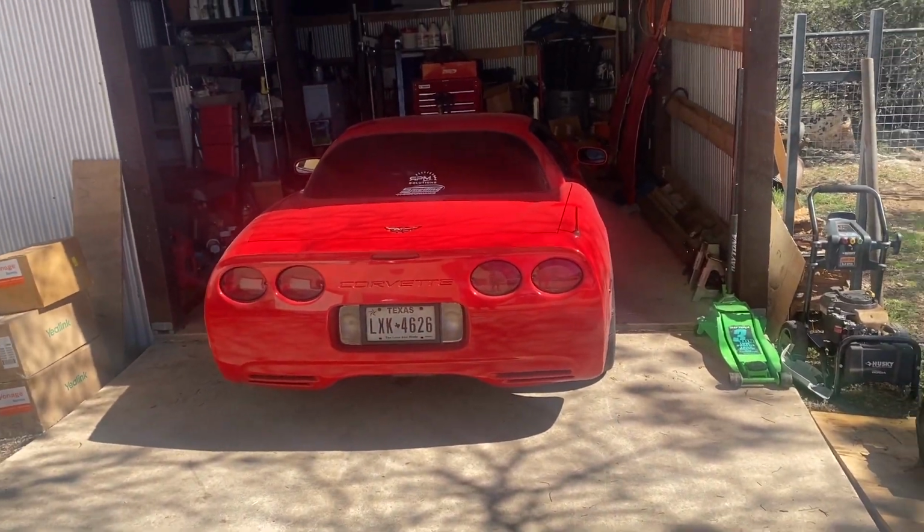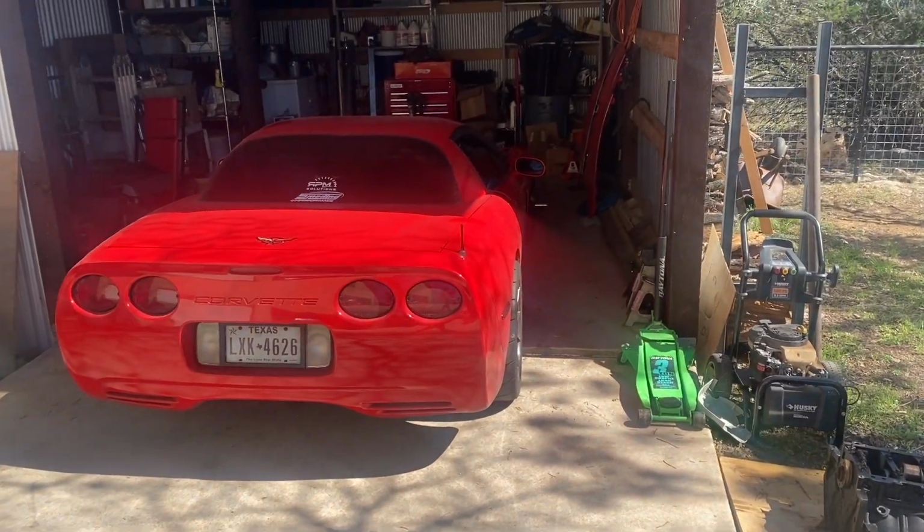And I could actually visually see the bottom of the piston skirts, which I was pretty worried about because this is a Gen 4 6.0 truck iron block, which has the shortest cylinder sleeves of the LS family. And the piston gets pulled about halfway out the bottom of that sleeve. Whenever you do that, the piston can rock a lot and it can collapse the skirts and tear it up. But while I had the pan off, I was able to look and everything looks perfect.